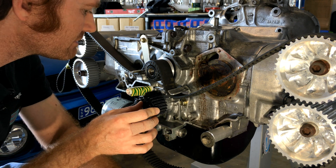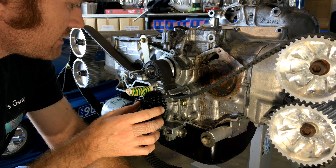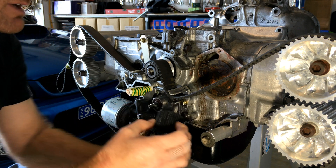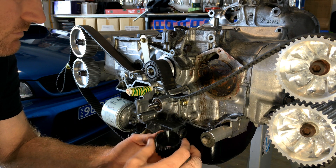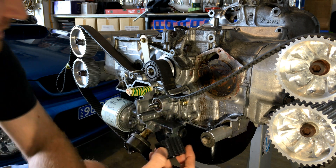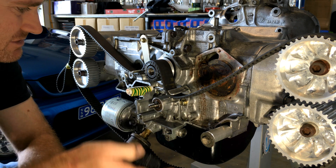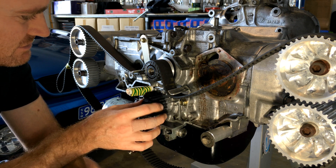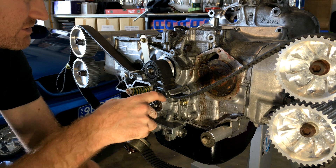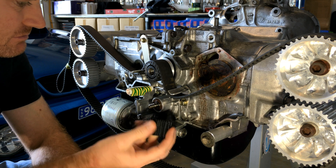Let's do a quick test fit. So now, because we've had to make this so small to match the size of the crank pulley so we don't under-drive our oil pump, we need some more clearance around the oil pump housing here. So what we need to do now is take the oil pump off and just shave these ribs off it, just to give us some clearance on the pulley.